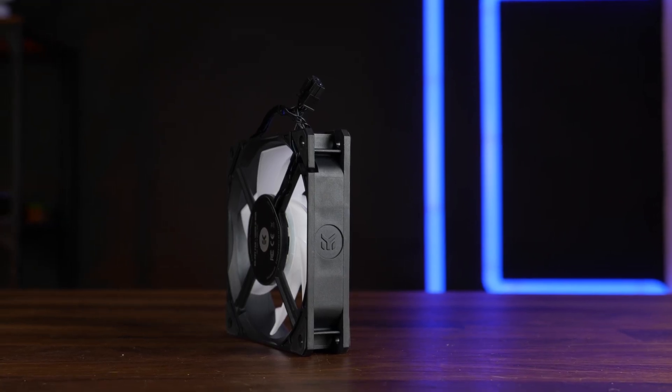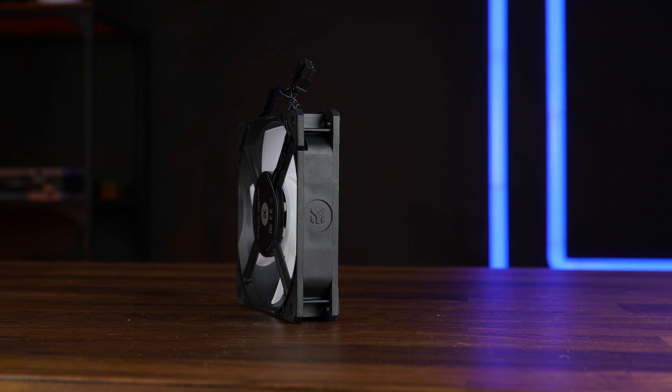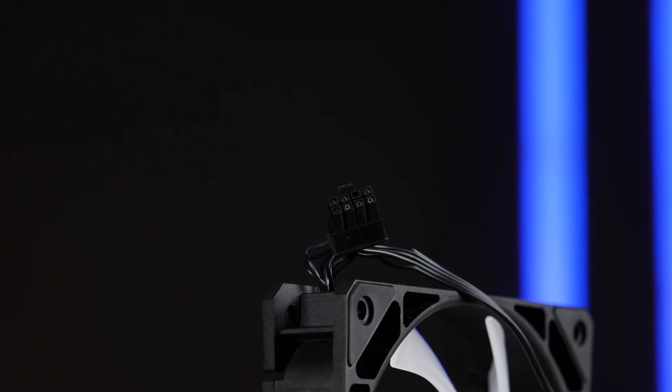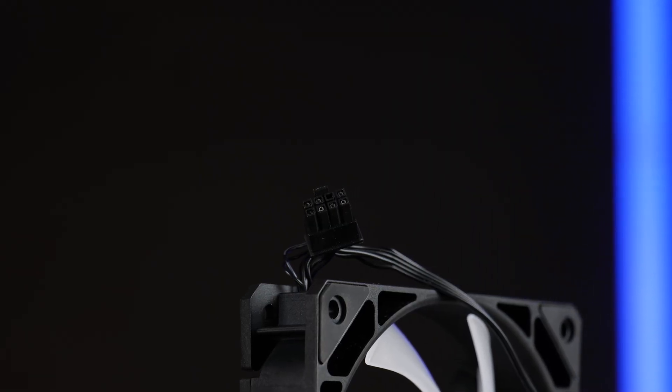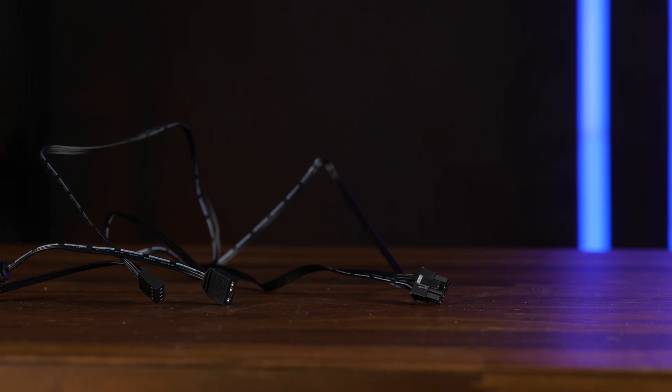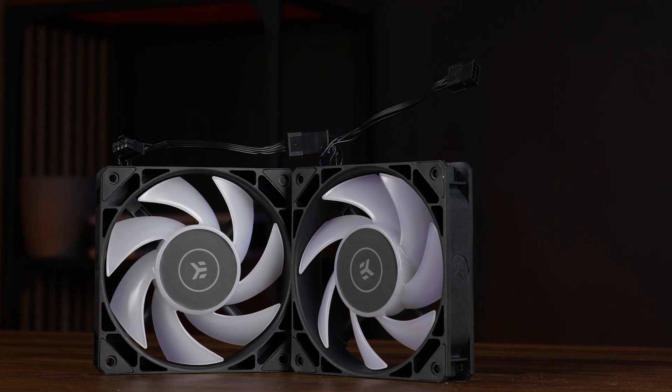We also got some relatively thick rubber around the corners on every side and some additional strengthening elements next to the mandatory EK logo stamped into the frame. But the most interesting thing about these fans has to be EK's connection ecosystem: OmniLink. To boil it down, it is basically a miniature version of a PCIe 8-pin connector. Hidden in there, we got the 5-volt ground and data needed for 3-pin ARGB, and the ground, 12-volt, tacho, and return for the PWM. From there, we can use the included adapter/extension to get back to regular PWM and 3-pin ARGB, or daisy-chain to another fan via the splitter on the very short cable. I already talked about this connector in the Nucleus review and I freaking love it — I can grab it with my fingers, it stays in securely, and it won't break easily because I don't need to pull on the wires.